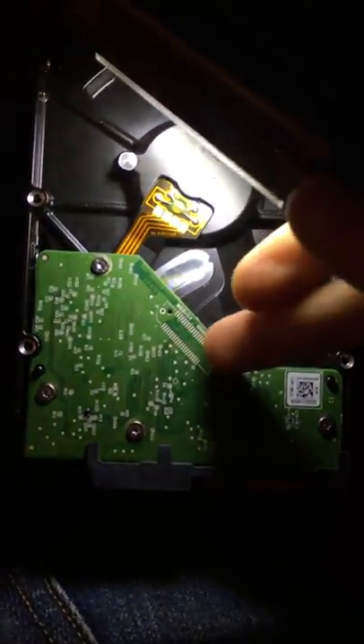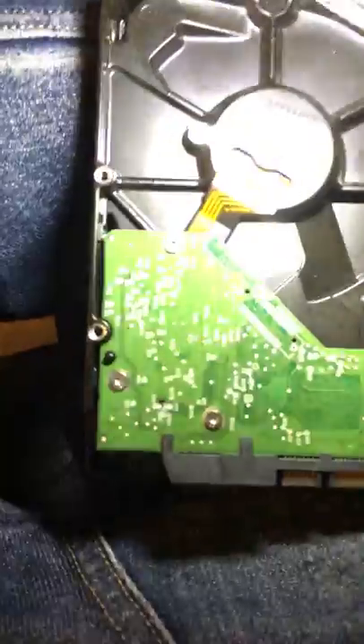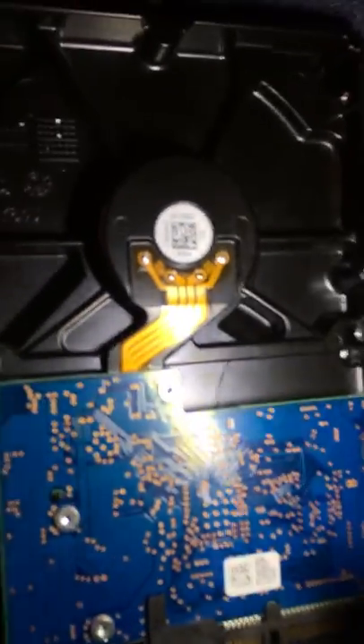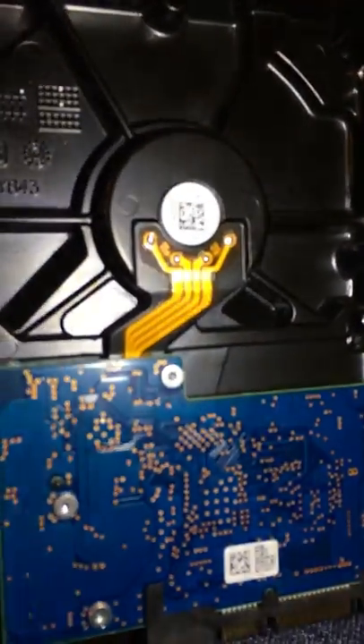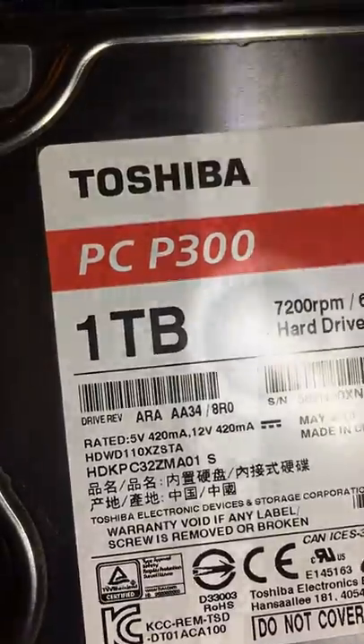These two drives right here are not working. There may be some hope though — seems to be a PCB issue. I swapped — there's a BIOS chip on the back, I can take that off, put it on a replacement board, and this one could be up and running. Same goes for this Toshiba drive, but I can't get help for that because I can't find a matching PCB — this exact model is one letter away from being mentioned anywhere on Toshiba's website.